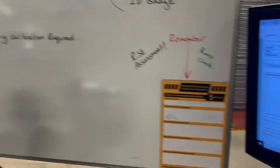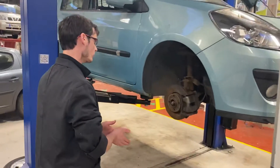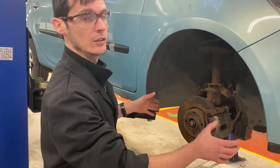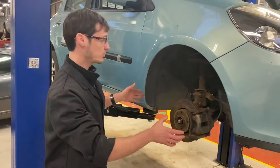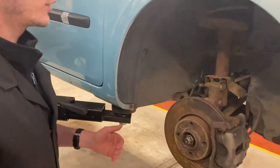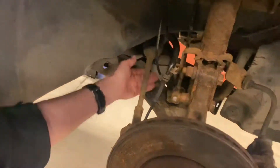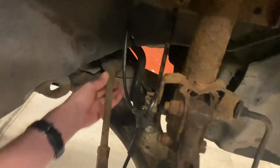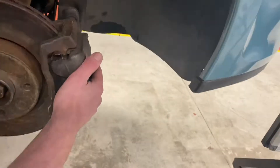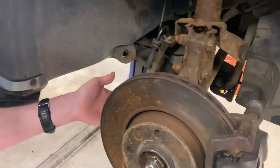Coming over to the car, the first thing I'd do is shake the wheel left to right, make sure the steering locks off, to see if there's any play in that track rod end. I've done that and taken the wheel off. I then identify the track rod end — the steering arms connect to the steering rack, and the track rod end sits on the back of the hub, though sometimes it's on the front.